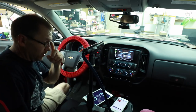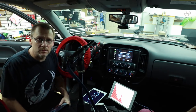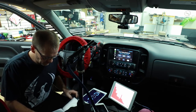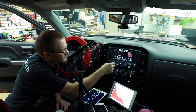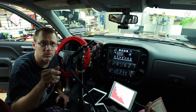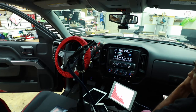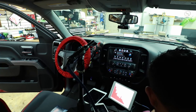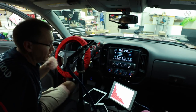The gains are turned all the way down, so let's take care of that. The cool thing about these amplifiers is they have a distortion detector very similar to the DD1 built in. All we do is play some test tones and we'll be back in business — we can turn the gains up and watch the little lights, exactly the same as the DD1. We play our zero-dB one-thousand-hertz track, turn the radio volume all the way up, then play the 40 Hz negative-five track. We have a preliminary gain setting all set and ready to go.